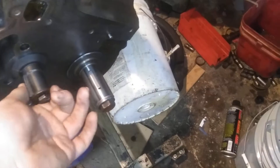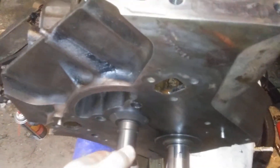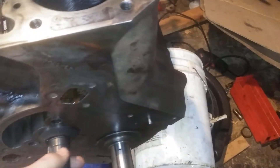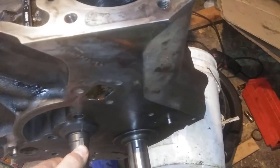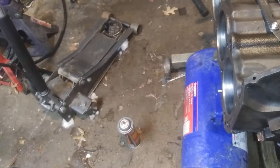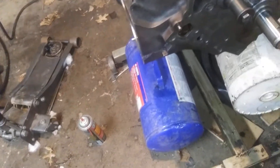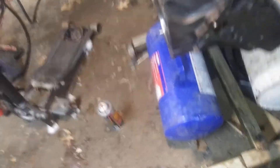I got a mock-up cam — it's a free cam I got with the engine. It is fairly tiny, basically an RV cam for a Buick 350. It's like 439/439 lift, 252 advertised duration, I think on a 110 lobe separation — it's pretty tame. So instead of using this, I ended up buying another Crower Level 3 cam, which is not too hairy. It's 448 lift, 476 lift on the intake and exhaust. It's got about 20 more degrees of duration on the intake, 281 degrees on the exhaust, and it's on a 112 lobe separation, so the lobes are a little bit farther apart.